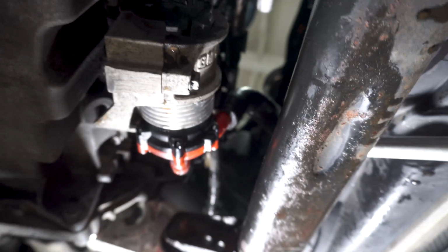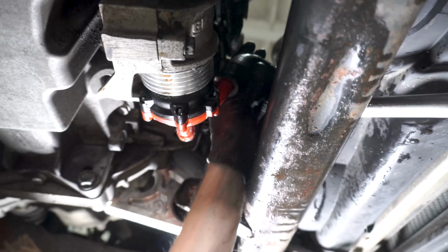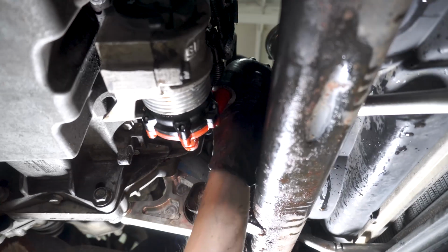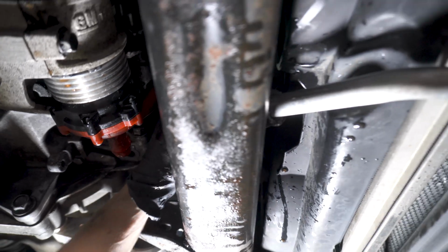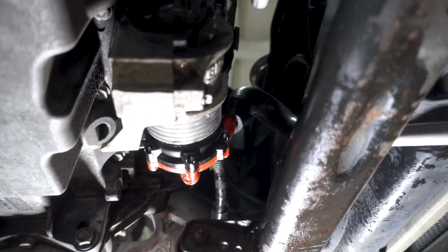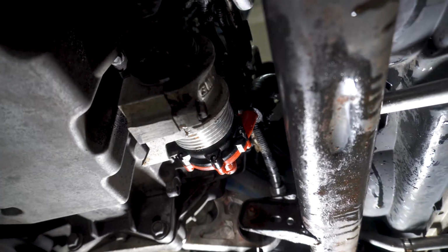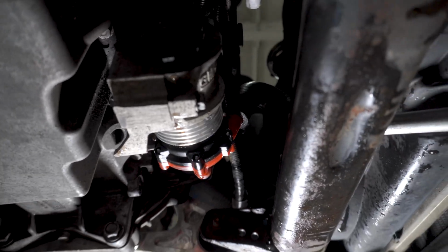There we go. Now what I'm going to do here real quick is, thank you Eric, actually rotate. I might not have to, but you just want to feel your bends. Want to make sure that they're not going to be a restriction, that they're not getting kinked anywhere. This one feels pretty good. It's just 2 13s, and then you can orient the pump whichever way you want. Mine's feeling pretty good. I'm pretty confident in that. So I'm going to go ahead and tighten these guys up.